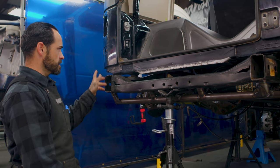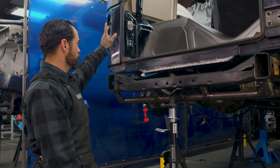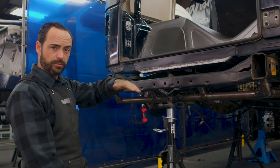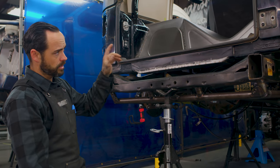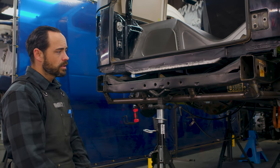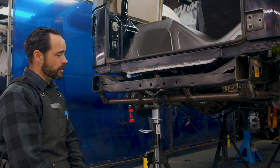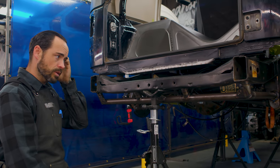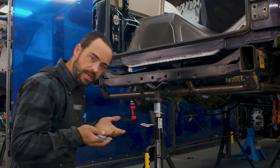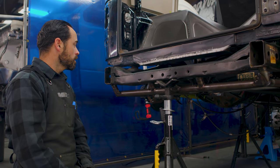The fuel filler is a little tricky here because it's using the factory tank. The fuel filler is usually on the driver's side, but there's too much going on — especially with how much it bumps when it compresses — so we need to get that going on the passenger side. It's not a huge issue; we'll probably incorporate it into the fenders. You've got to build this thing pertaining to what it's supposed to be doing and getting that low ride height while still retaining six inches of up travel at ride height. That was the goal, and that's what we have here.